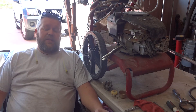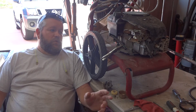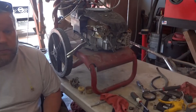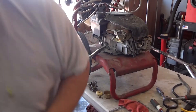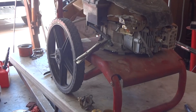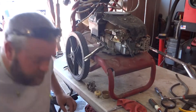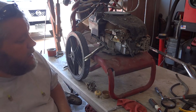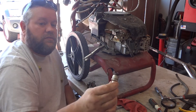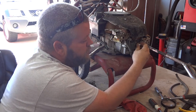I haven't really had any use for it — everything I've needed to pressure wash has been kind of big, so I've been going to the local car wash. Pulled it out yesterday and I could just barely get it to run, then it would die. Finally pulled the plug and checked it. It's running really, really lean, which I knew, but it's actually really bad.